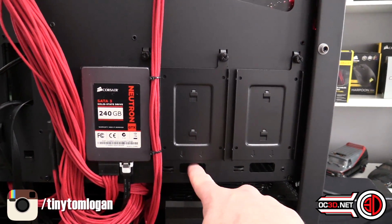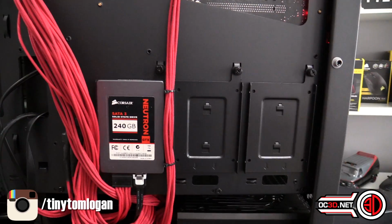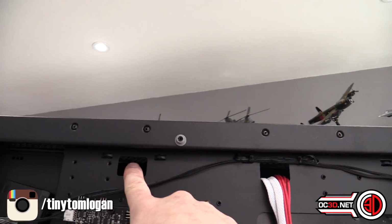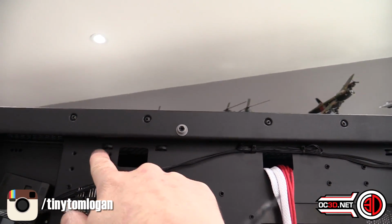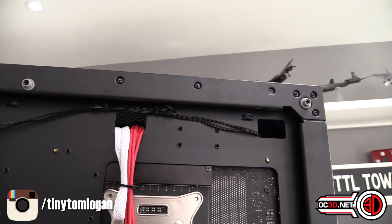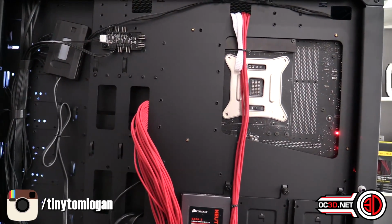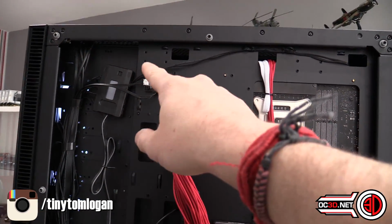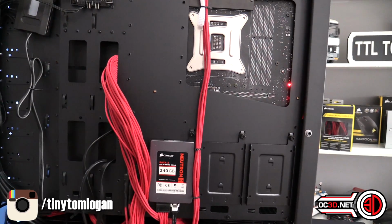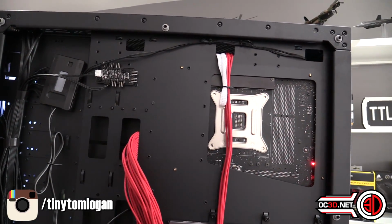But the other thing you do need to consider is these are right at the very bottom, and we know that this has extra PCI slots, so the actual motherboard's up here somewhere, which I will show you when we're on the other side. Up on the top though, got 3 decent size pass-throughs, and then lots of the little latch downs that you can clip your cables up should you want to, which is all kind of nice. You can already see from the back side here that there are lots of little screw points for motherboard standoffs, and they are everywhere. So the actual motherboard support for this case is immense. You could literally server the bejesus out of this, which, yeah, we do just need to get round the other side, I suppose, now.